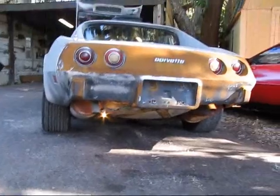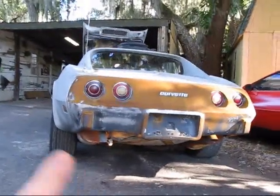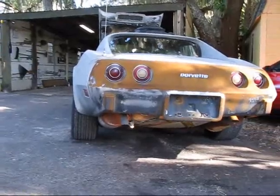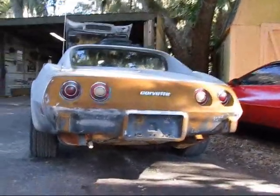You can see my backup lights are on because I've got the key on. I took them out of the socket because they had burnt the left driver's side socket — it actually melted the plastic because it stayed on too long. I didn't want to burn the other socket too, since they're not supposed to stay on that long.